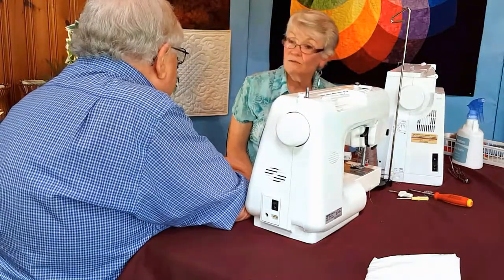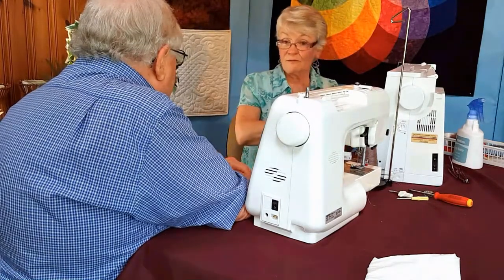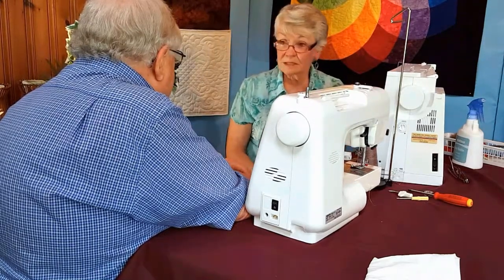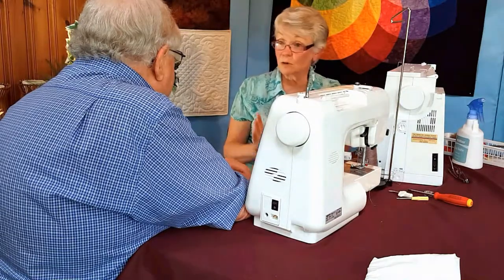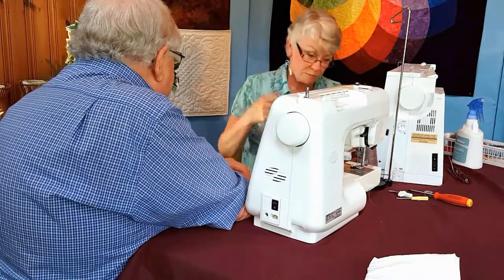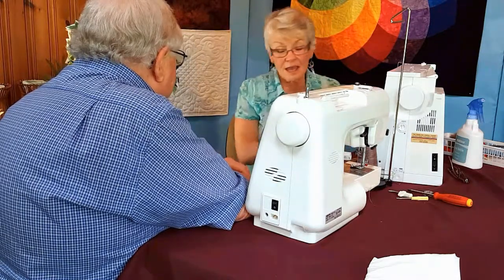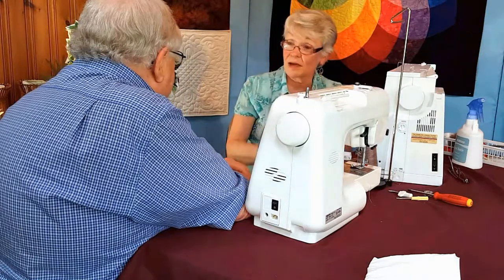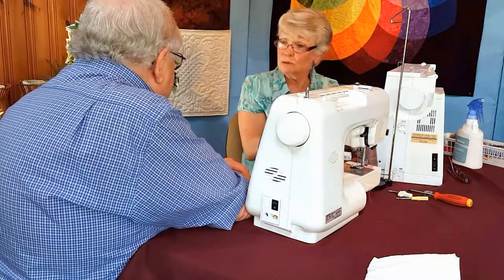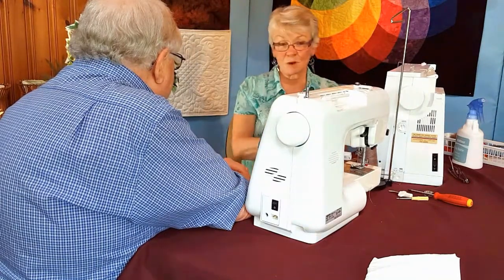Do you want a little bit of historical trivia? Well, of course. If you were a Sears sewing machine dealer back in the 50s, you would have the most amazing collection of used machines. Someone would come in and say, I don't really want a new machine, I want a used machine. Well, come on over here. And they would be pristine. Plug it in, sew with it, cha-cha-chunk, cha-cha-chunk, because they were washed with kerosene. Took every drop of lubrication out of it, and that's why it did the cha-cha-chunk. Looked beautiful, sounded awful. Well, you know, it's a used machine, I'm sure the stitch is good. You go over to a new machine, quiet. The only difference was lubrication.